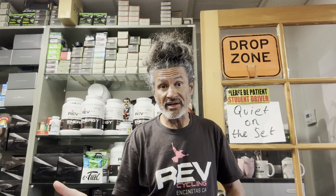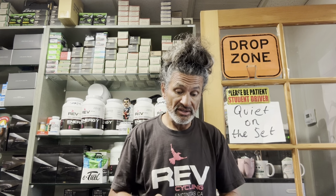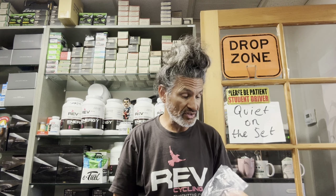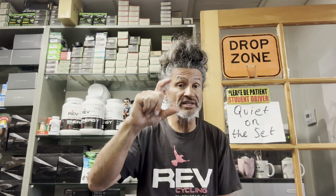So rather than order a set of wheels and then be stuck, I said, okay, let me order a free hub body, and let's see if we can get the free hub body onto one of my wheel sets, build this gentleman's bike with the Super Record group, and see if we can get this to work. If it works, then we'll order a wheel set for him, brand new, with the Campy free hub body and all that stuff. And I believe at the last time we spoke, he wants the 46 millimeter deep wheels, the RC4 or R4C, one of those two, but it's 46 millimeters because he saw it on my Breakaway and he says that looks snazzy, and it does.